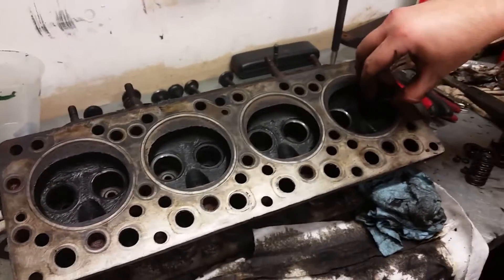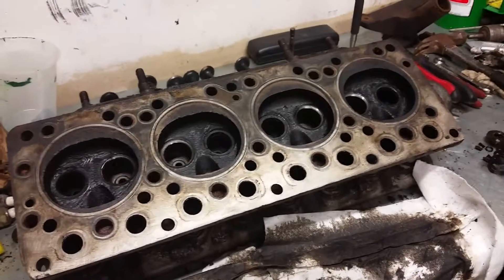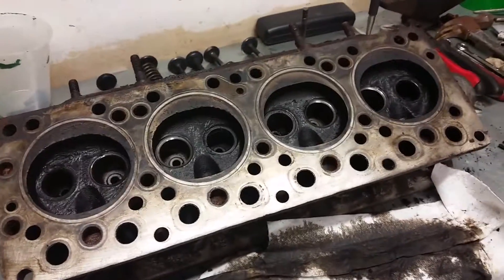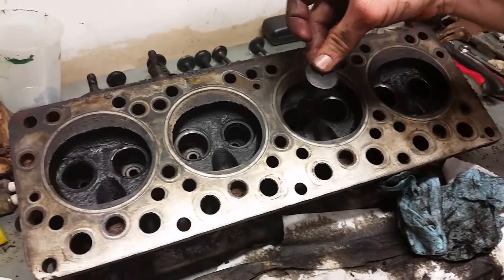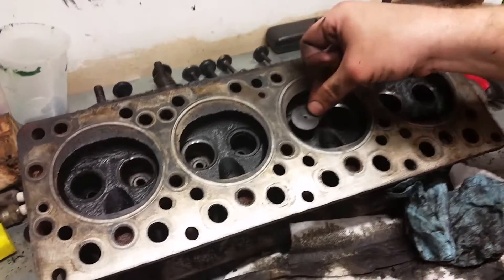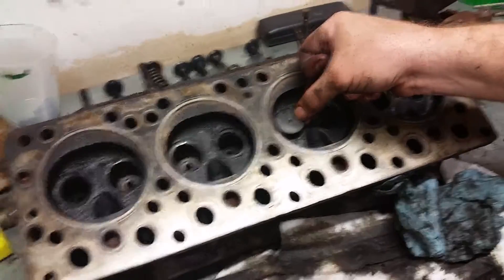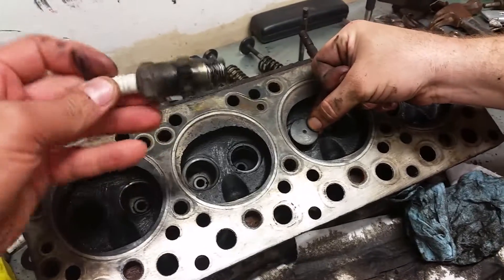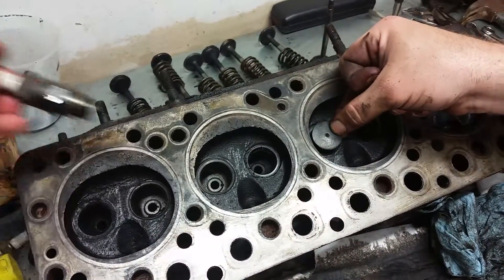Just for your refresher: the two center cylinders were completely dead — nothing. We cleaned the spark plugs out, we had anti-fowlers over the plugs, and no matter what we did they would foul out within about 30 seconds. You can see how it coked up with oil and carbon.